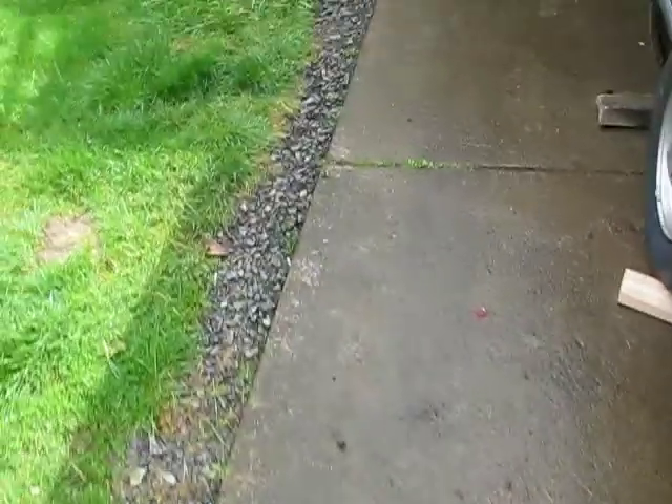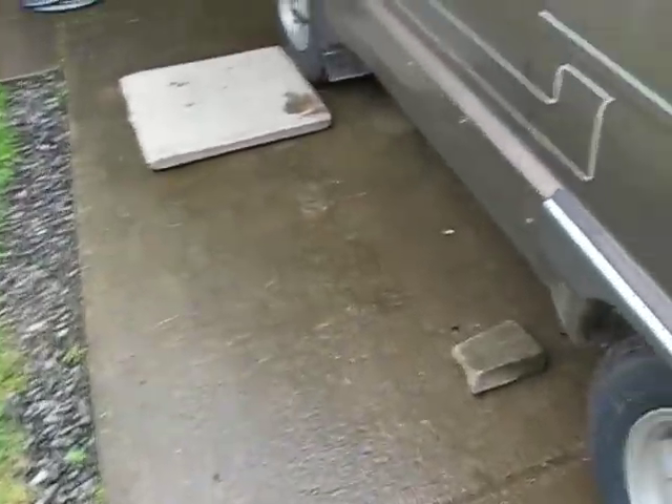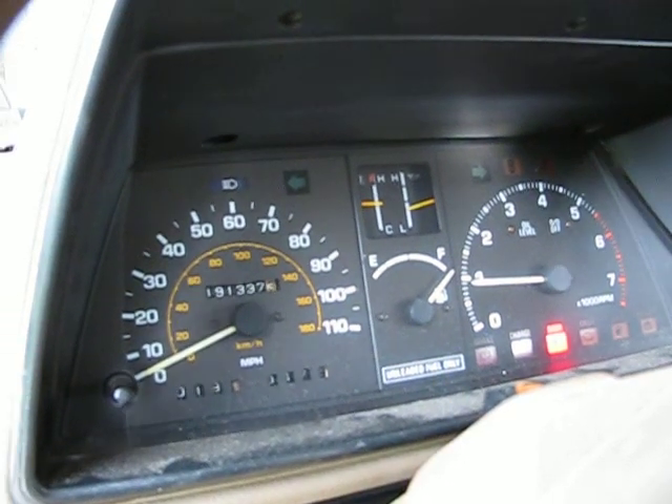Due to availability, which goes against my better judgment, I purchased a clutch fan for my van from Napa, because my old one was just plain shot, and put it on. It actually worked good, but the problem is it wouldn't engage until my temperature level was almost an eighth of an inch away from the red on the gauge. I didn't like that, so I took it back out, actually several times, and was trying to adjust it.